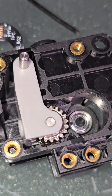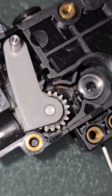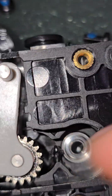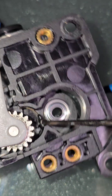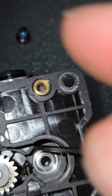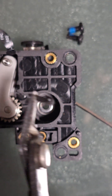I'm going to see if I can push up from the bottom here. If you can tell, I pushed up on the filament from the bottom and was able to get it to this point - it just was not going up or down. There was really no option, I was going to be pulling apart this extruder gear assembly. There you go - basically that's the filament that just got bunched up.